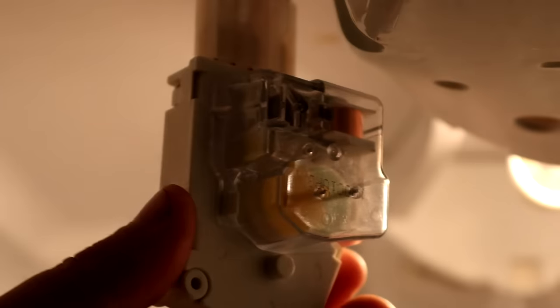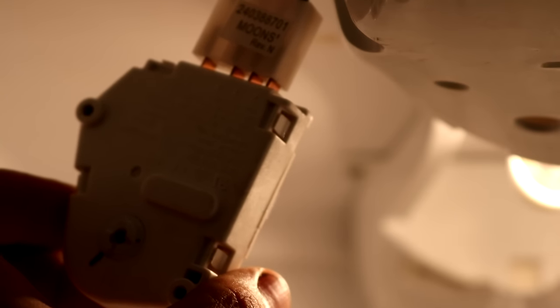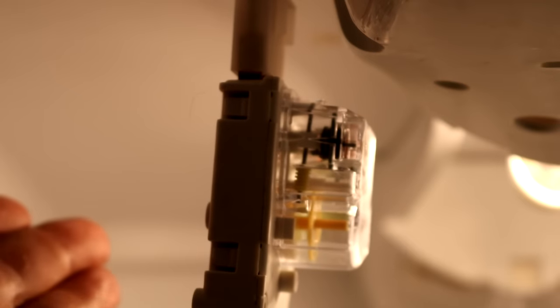So now we've got to go back and focus on the timer. If your freezer vents are completely frosted over and you can't see the heater, just wait a few minutes and listen — you'll hear water drip off the evaporator and sizzle on the heater. Because my heater came on, that tells me the defrost timer just stopped in the middle of its run cycle and was never going to advance around to the defrost portion.